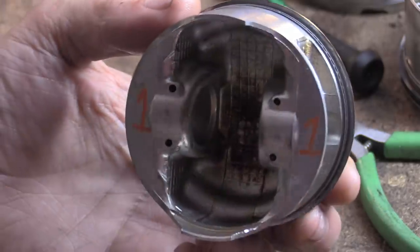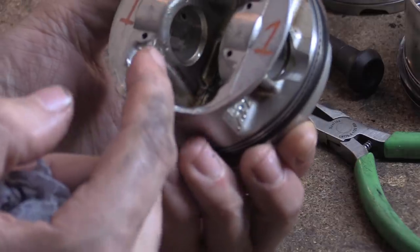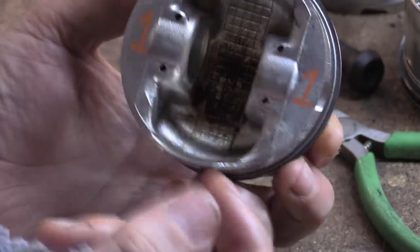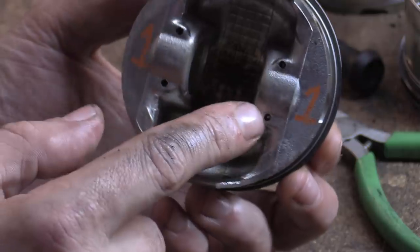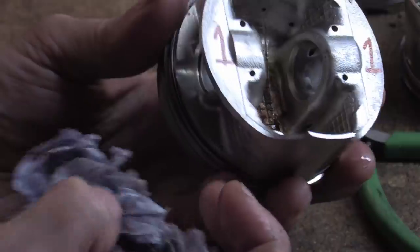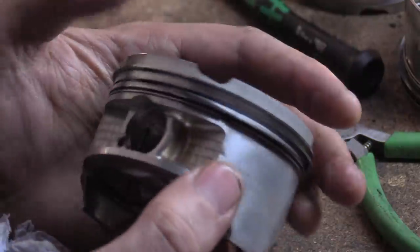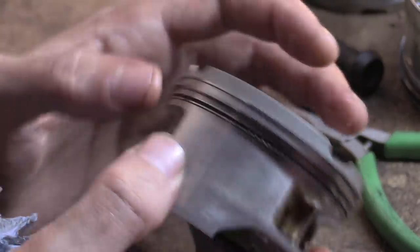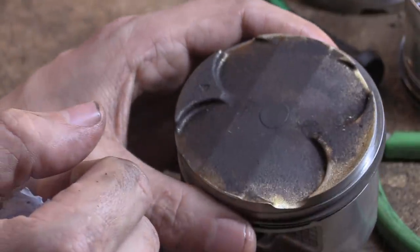As oil drips off and as the piston goes to bottom dead centre, oil flings off due to inertia and momentum. It goes really thin and if it's really thin it cooks — completely normal. These holes on the side are oil drain-back holes — it's actually a bit of both feed and drain-back for the wrist pins. We'll also see holes in the ring lands in a second. These cutouts here are valve reliefs.